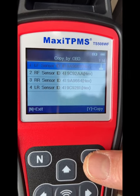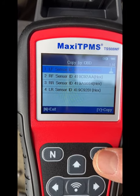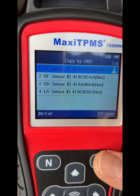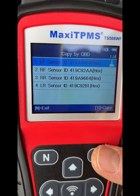We're going to do number two, but I have to go and let the air out of that tire as well. I'll go around the vehicle and do all four tires. Notice on the left side number one is left front sensor — don't mix those up. Then we do right front, then right rear, then left rear in order.